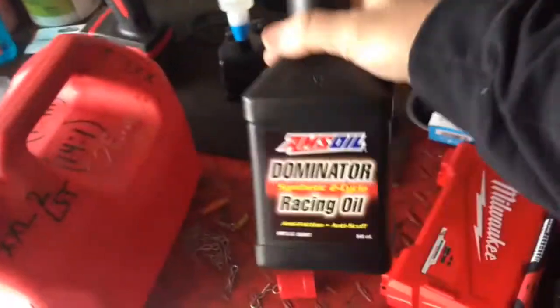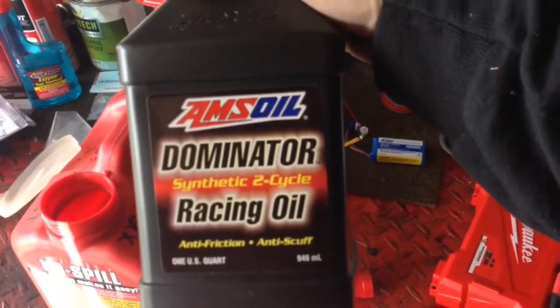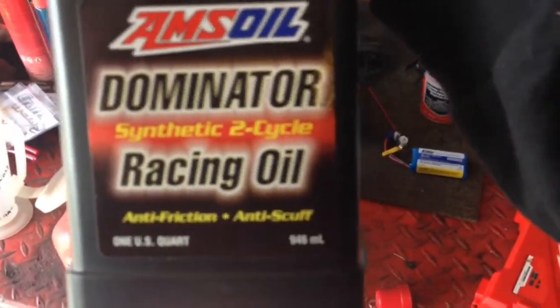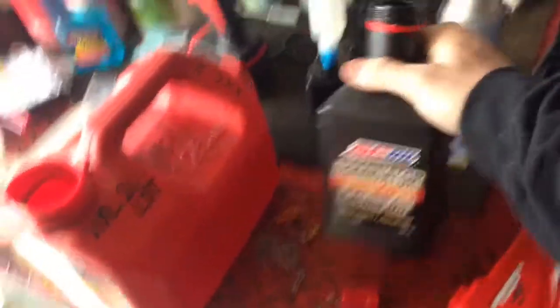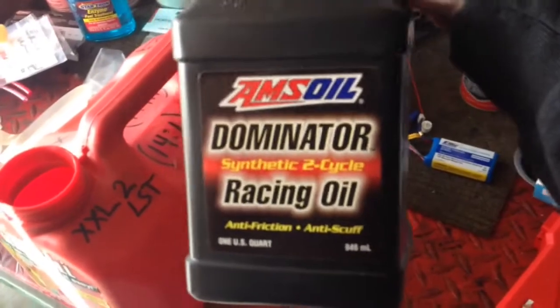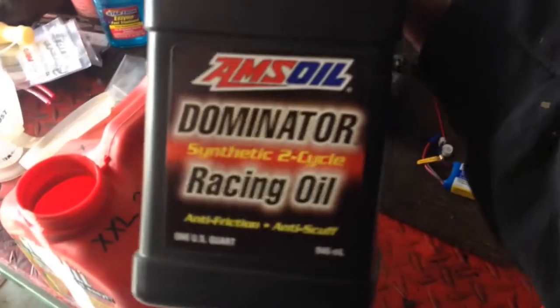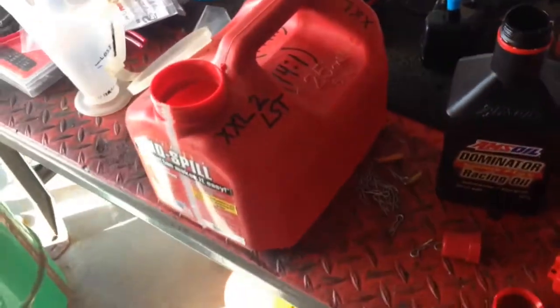We're gonna run what I think is the best oil you can get for two-stroke race engines running on Cam2. Guys running pure ethanol fuel or special race fuels mix with this on their high-performance two-stroke motors — high-performance banshees, 250R three-wheelers, anything high-performance. My buddy in California actually gained performance on his banshee by using this, and a guy in Alaska who races high-performance two-stroke snowmobiles runs this as well. I'm going to be running this from day one and sticking with it.